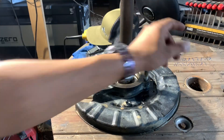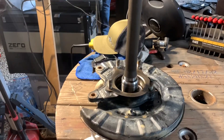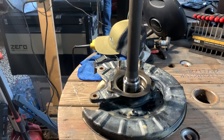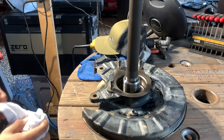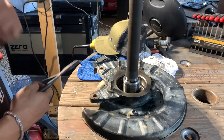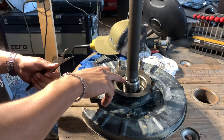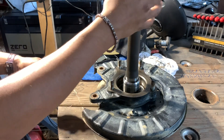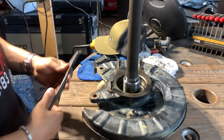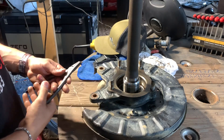So the rest of the truck is torn apart. The inner seal — which we thought would be considered the outer, but it's not — there's actually another seal inside, which is the outer. I'm going to have to wait until Friday to get the new seals for the inner and then we'll replace it. In the meantime, we're going to remove the C-clip here, which retains the stub shaft. Once we get that out, the hub assembly will come off the axle shaft, and then from the face side we'll press it out on the press.